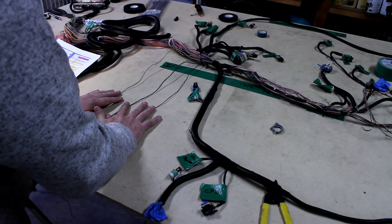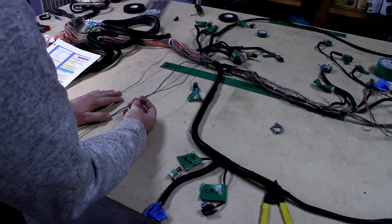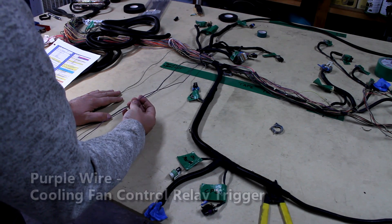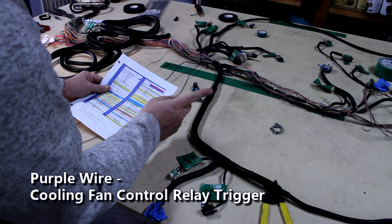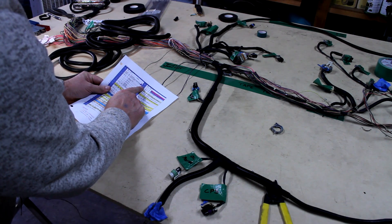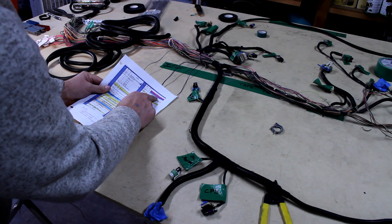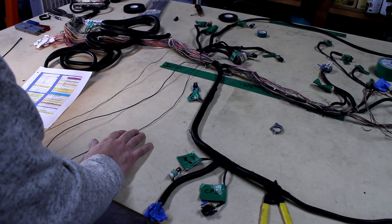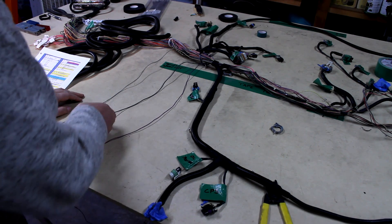I've done research. I forgot about the purple wire — this was originally used in one of the O2 sensors that I repurposed for the fan control relay. It's still in the harness back there, and specifically I need to add a wire to pin 42 of the blue connector for my cooling fan relay control. This is not a problem; I'm going to reroute it through the harness back over to the blue connector and punch it into pin 42.